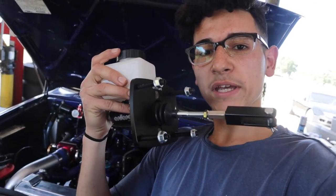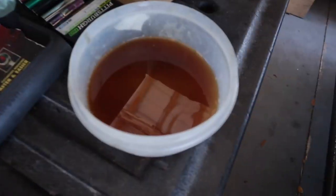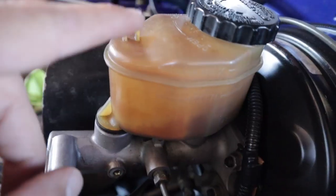What's going to be the hardest part of this upgrade is doing the brake lines. I have to get some custom braided stainless steel flexible lines so I can run them to the front brakes and one going into the rear brake line. I have to put the Chase Bays master cylinder on and then take measurements to see the length of hose I need. Here's the container with my old brake fluid — you can see it was pretty dirty.